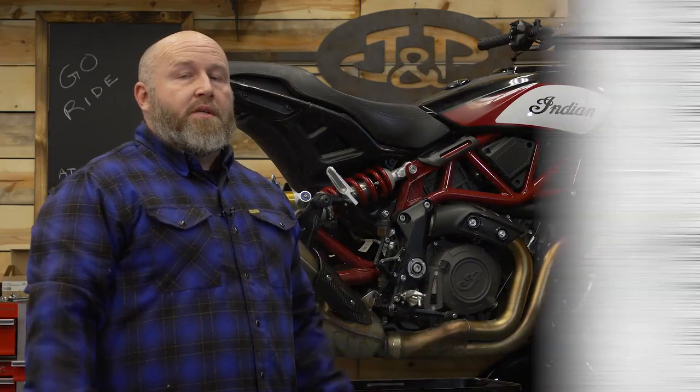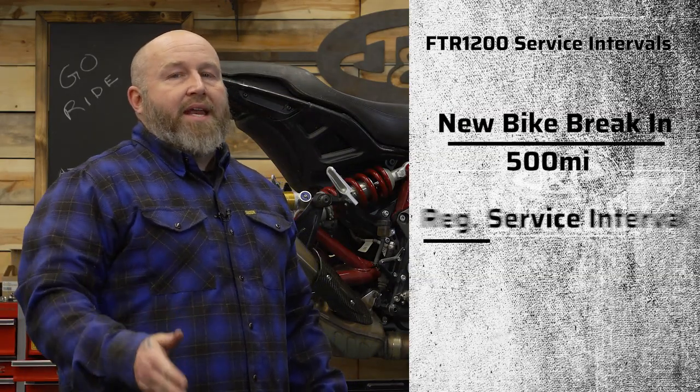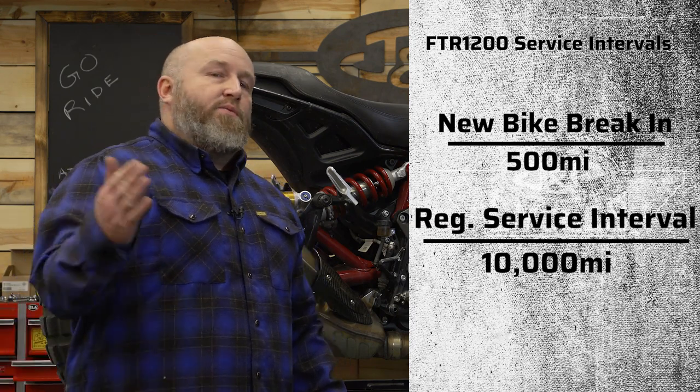Now, when should you be doing this? If it's your first oil change, brand new motorcycle, 500 miles. After that, every 10,000 miles is the recommended oil change interval. You should probably do it a little sooner than that in my book, but Indian says 10,000, so that's what we're going with.